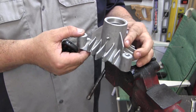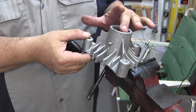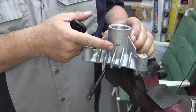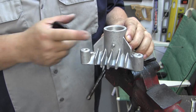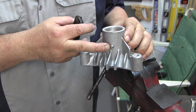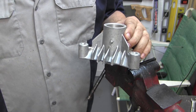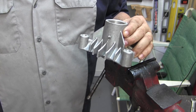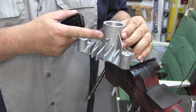If you do this to your bearing mandrels and pull the seals off the inner side of the bearings, it is a commitment. You have to keep these packed full of grease once you pull those seals off. The only way to keep the grease up in the bearings is to keep this pumped full of grease. I would say every 10 hours or so of use, just hit it with a grease gun. They'll be in a convenient spot — just reach up and pump a few strokes of grease in there. But if you decide to do this, it is a commitment you've got to do often.